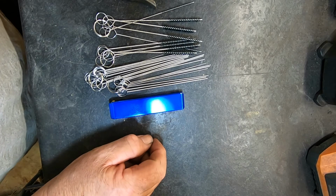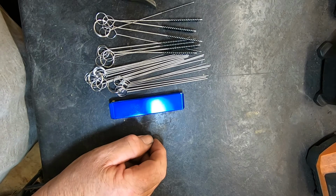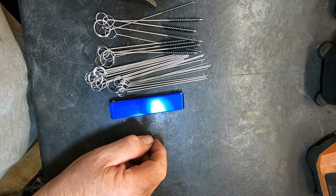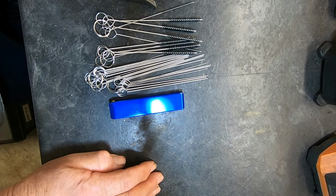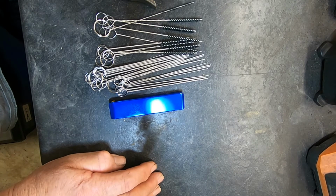One common symptom of a carburetor that has ethanol damage is that it'll only run on full choke because the main jets are clogged. The reason it'll only run on full choke is fuel can't get in the normal way, and when you choke off the engine, it creates vacuum, and the vacuum from the engine is what's drawing in the fuel. Once the motor starts to warm up a little bit, then you can crack the choke open a little bit to get a little more air in. But you're actually controlling the flow of the gas and the air with the choke, which is not good.